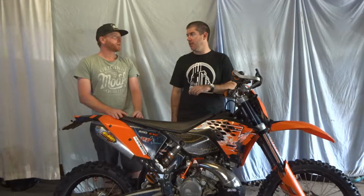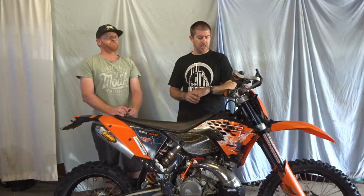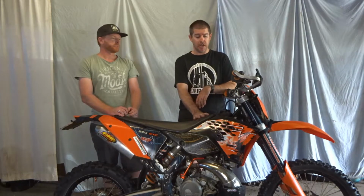How many hours do you think it's been since you did the top end? Probably between 70 and 90. So on a 200, 100 odd hours is getting up there for sure. Yep. And they do cop a lot of abuse for sure. So what we're going to do, first step is we're going to do just a dry compression test. So we're going to take everything off the top here, get to the top of the head, we're going to put our compression tester in, no oil, no nothing, and just see what we end up with.